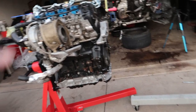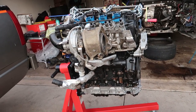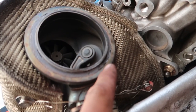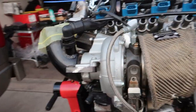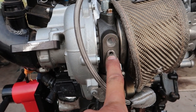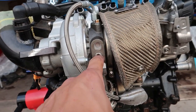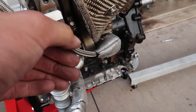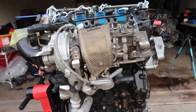Motor's off. Trans is here - it's good. Tomorrow we'll pull apart the transmission, and then we'll get to the motor eventually. I need to cover up the exhaust side here - I didn't see any new gasket. I'm going to need a whole new turbo blanket anyway. My safety wire is kind of crap because I was doing it blindly. I'll actually be able to fit this bolt in. I haven't run out at all since I installed this turbo - the o-ring in there is super tight and this kind of keeps it. Never got a leak. But I did kind of crush my oil line - I need to get a new oil line.